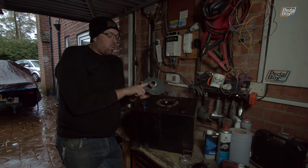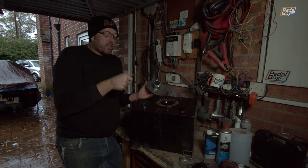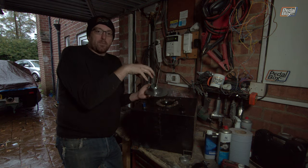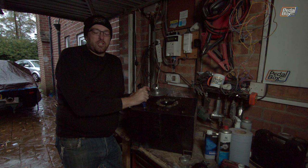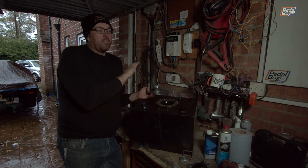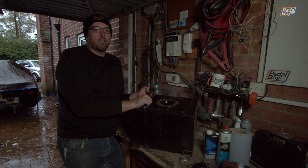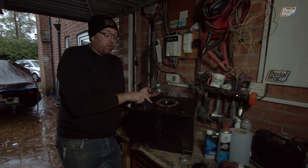I've tried to work out some way to integrate this into the bodywork so we could have a filler port on the side of the car, but that's going to have to be a later problem. We could have one of those surface mount caps like the old Cobra style or a Charger where it pops, but having it on the front of the wing just wouldn't look good — it would look absolutely terrible, just like a big wart as you drive along. For a flush mount we'd need something with the same curvature as the body at the very top of the wing, we'd have to make a recess pocket — extremely difficult. So we're just going to open the bonnet in order to fill the tank.